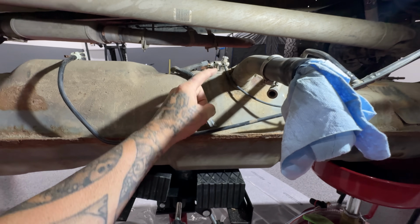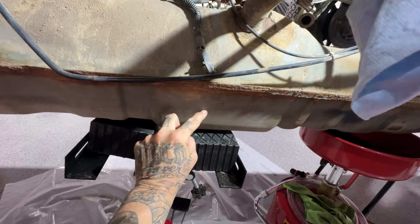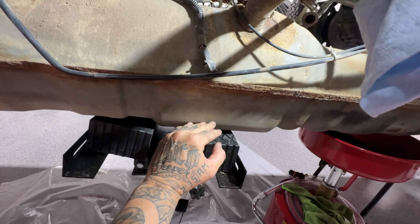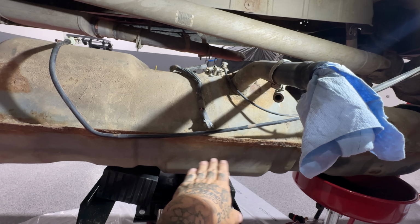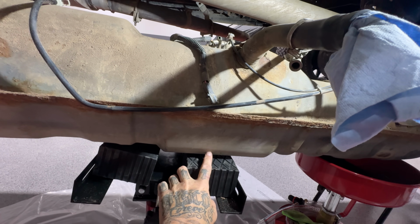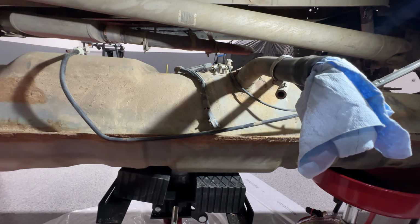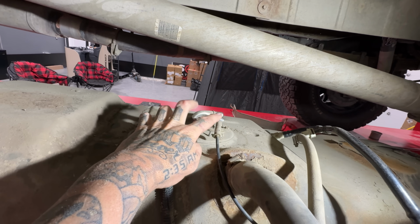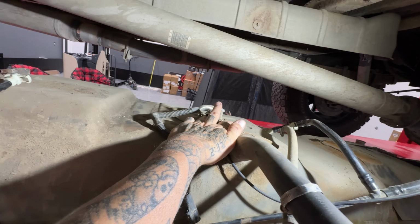And on the inside of that is a line that goes down to about a quarter tank of fuel. So if I'm ever below a quarter tank of fuel, then usually my heater doesn't work. It needs to be above that line. But they do that so you can't suck your fuel completely dry while you're trying to heat yourself and not be able to start your vehicle. But yeah, that's how it's tapped in. These are little things on the van that we just never get to see, so that was pretty cool.